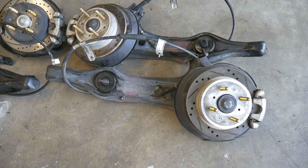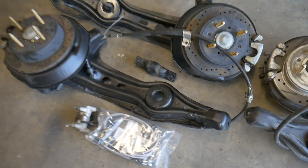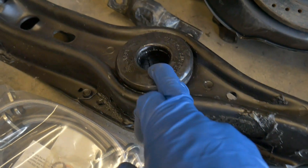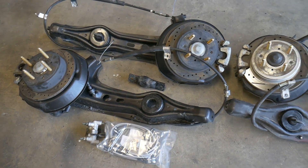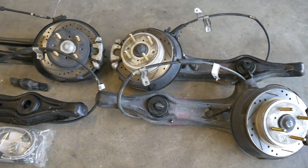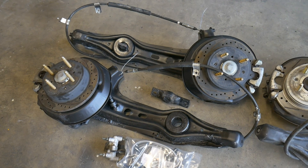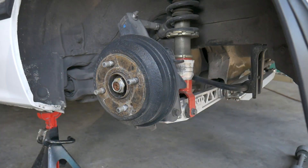This set is a set of 90-91 CRX SI trailing arms. This one is from a 90-93 Integra — the big indicator is the size of the trailing arm bushing; this one is a lot smaller comparatively to the DA. Some people have also used the 92-to-2000 Civic EX/SI rear trailing arms, but I've never had experience with those. If you know they work perfectly fine and the suspension geometry lines up great, chime in in the comments. Pretty much all 88-to-91 Civics and CRXs came with drum brakes.